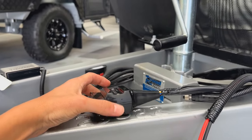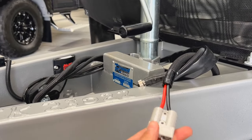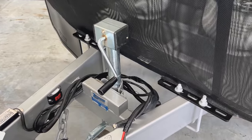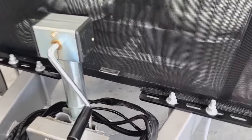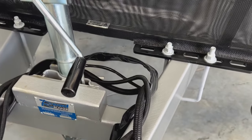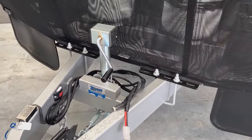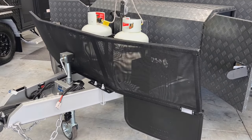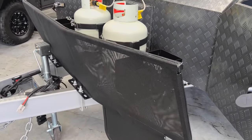There's a 12-pin plug at the front, which is a pretty standard gray Anderson plug for battery charging through the DC to DC charger that's fitted inside, which we'll have a look at later. There is also the cabling for the hardwired reverse camera fitted to the rear of the caravan. Just beyond the jockey wheel is the Deflector Australian-made Stoneguard shield.